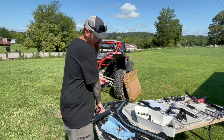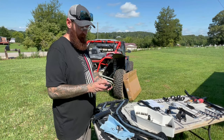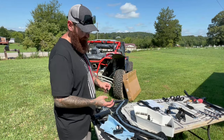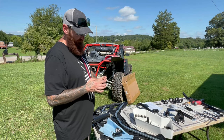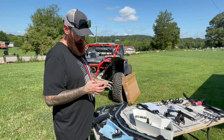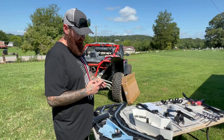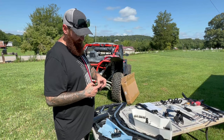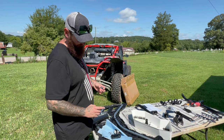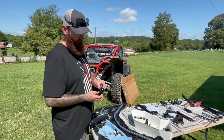As far as grease, I think a good light coat of, preferably, an all-weather grease, maybe stuff you would use, I think Lucas sells, that you could put on your boat bearings and stuff for your boat trailers, so it won't get washed out. For little small minor stuff like this, that's what I would use. So just as a recommendation, point that out.